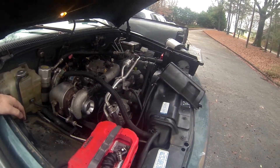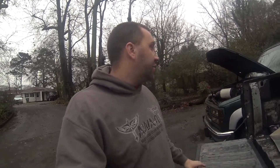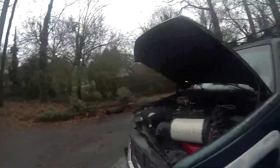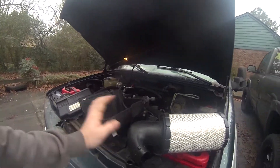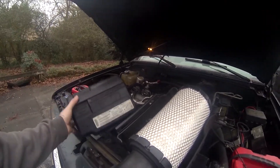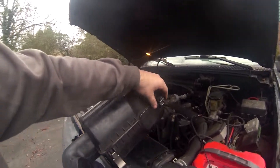So that's what that looks like. Guys, if you happen to stumble across one at the junkyard, get it just to sell it. If you don't want to put it on your truck, just sell it. If you do want to put it on your truck, word on the street on the internet: it is better. If you can afford the money, the S&B aftermarket one probably is the best one — but there's not a whole lot of automotive testing in the 6.5 diesel community, is there? It's just kind of he-said she-said type stuff. So this is what the K47 intake upgrade is — this is the box you're hunting for if you're new to the 6.5 community. I got mine off a used truck — some dude was parting out his truck, and I just grabbed this before he took it to the scrapper. I bought this in 2015, so five years ago.